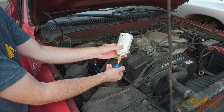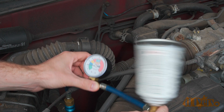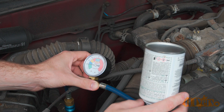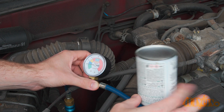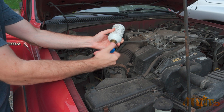Monitor the gauge and keep the pressure in the blue area — this is the safe zone. Depending on your recharge tool the colors may vary on what is an acceptable pressure range. It doesn't have to be completely full, but enough where it can operate the pump and recirculate the dye through the system to highlight a leak. Once done, close up the valve and remove the recharge tool.